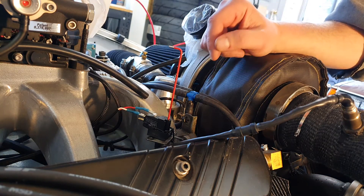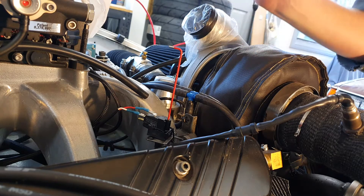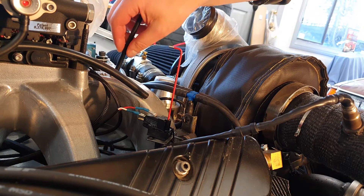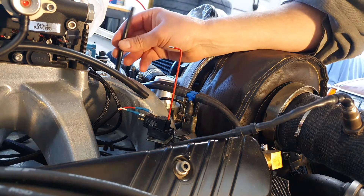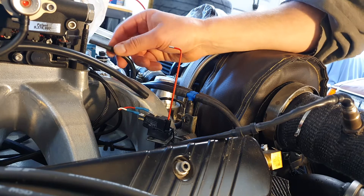I've turned the switch all the way clockwise. I'm not going to run the motor — I'm just going to leave the ignition on, because all I want to do is see if the pump works. I've plumbed the switch into my e-boost line, which gives it the same boost information straight off the manifold.